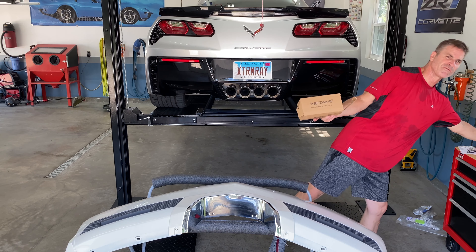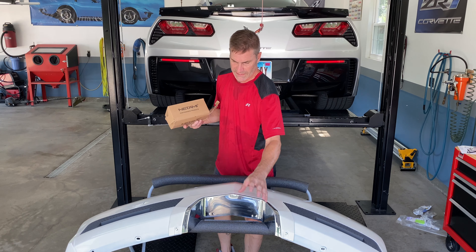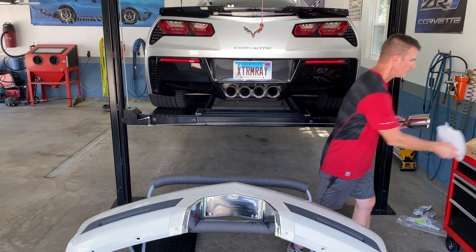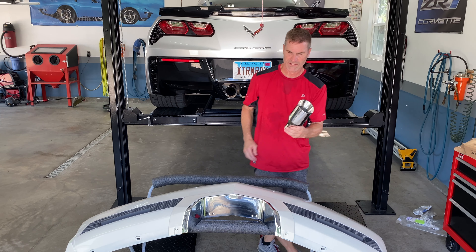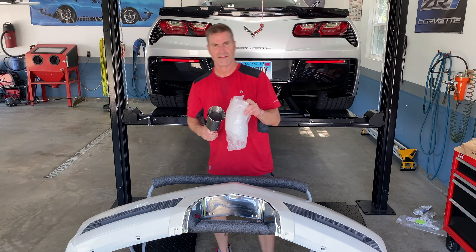I got on Amazon and was looking for tips. My son has the V6 - it's a base CTS and we wanted to emulate the CTS-V tips coming out. His tips end further back because he has that V-shaped triangular opening that the base bumper has. What I found were these four-inch inner and outer stainless tips. They're going to go here and they're going to look great. I think they're long enough that they'll reach back to where his current tips are, but I am going to have to do some modification. The tips that come out of his mufflers are rectangular or parallelogram, so I'm going to find a way to modify them and weld these on to his exhausts so they are part of the exhaust.